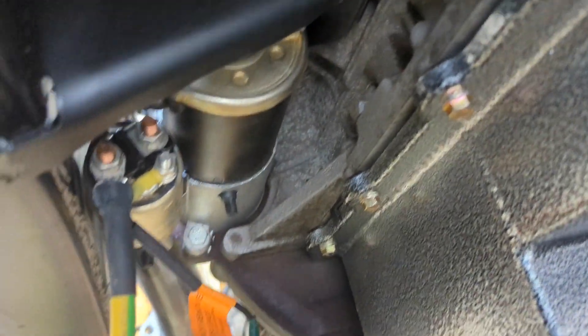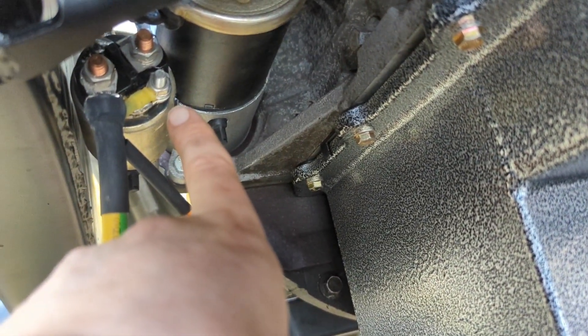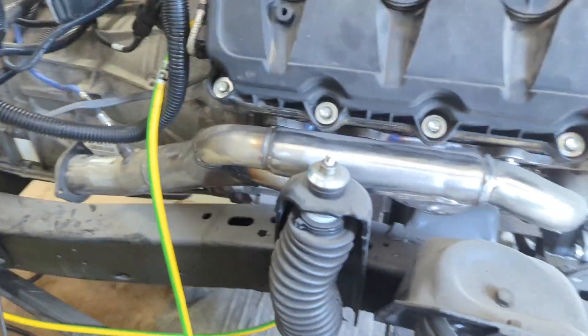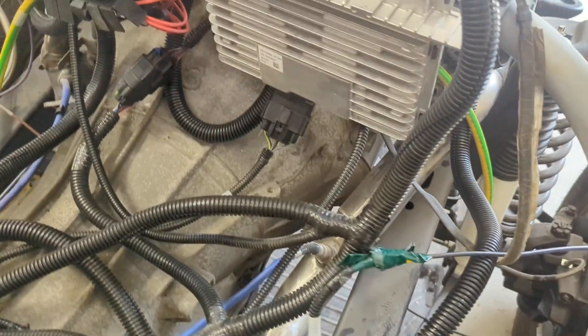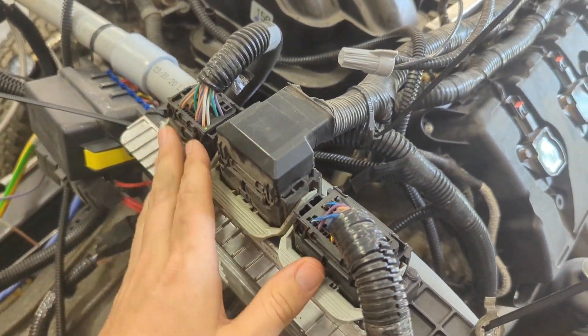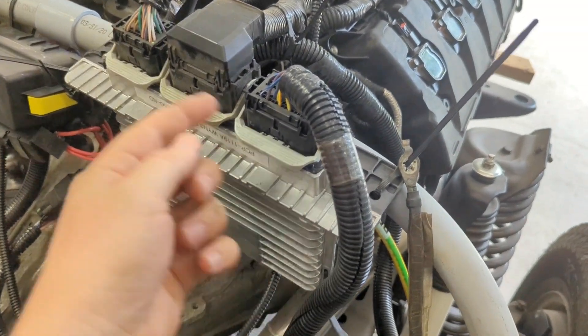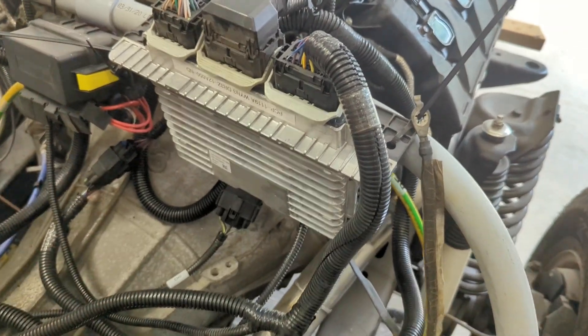I added a little stub piece that goes onto the solenoid portion of the starter — that little guy right there — and that makes the starter go. For the other connections, these three need to be on. Our computer is a pickup computer so it's got three ports; some of the later ones I think only have two.